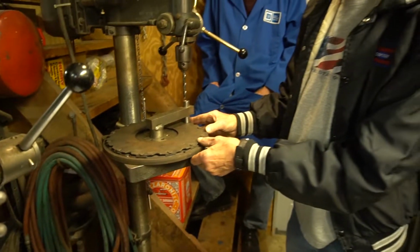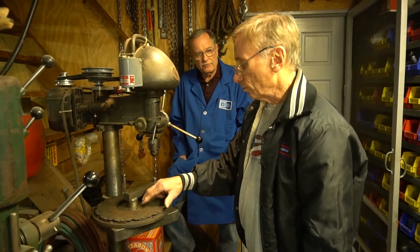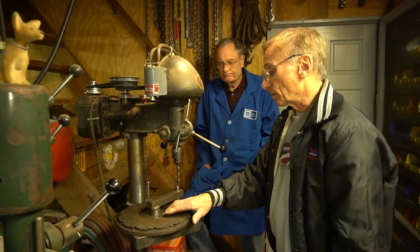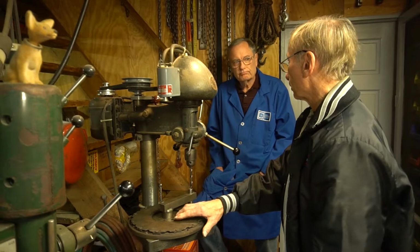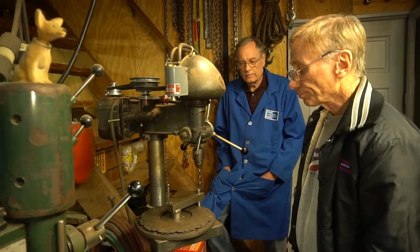And there are a lot of reasons to reject the flywheel, but those are just a few. I suppose heat gets involved in there too. If it had a heat crack in the face? Heat crack in the face, and sometimes the heat will warp the center plate where it's unusable. And there's nothing you can do to straighten them because they're spring steel.